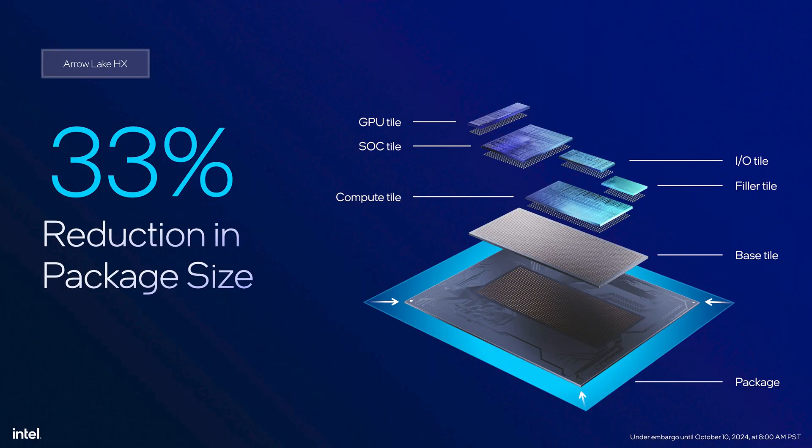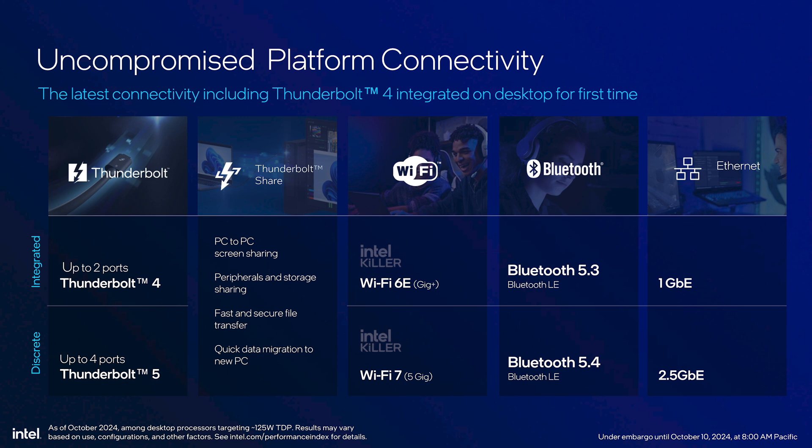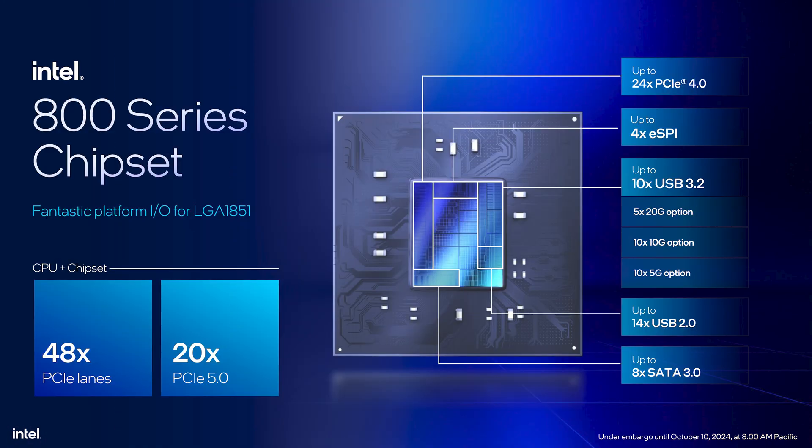Something that isn't huge though is the chips themselves — they're now 33% smaller, which might explain why we need a whole new socket and chipset. This will be LGA 1851, which is interesting because that means more pins, up from 1700 with the 12th, 13th, and 14th gen chips, and Z890 motherboards. That chipset is actually pretty impressive — it has WiFi 6E built in, meaning all motherboards should be WiFi boards, with the option for upgraded WiFi 7. Bluetooth is built in too, plus a 1GB NIC, with options for 2.5G or higher NICs as well. You get 8 SATA ports, 14 USB 2, 10 USB 3.2, and 24 PCIe lanes from the chipset. The CPU itself has 20 PCIe Gen 5 lanes on board with the usual 16-to-4 split for GPUs and an SSD, plus a Gen 4 link to the chipset.